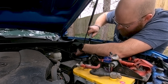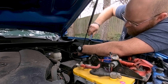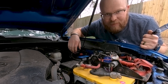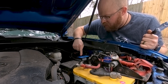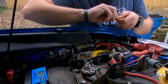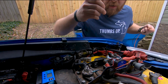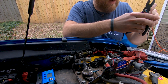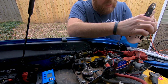I need some sheet metal screws, which I currently don't have, so I'm going to temporarily use these coarse thread construction screws — which I would never do usually, but, you know, times of crisis. So now we need to get the wiring situated. I'm going to wire this to the battery first and then wire from here to the panel. These Genesis trays make it really easy to wire accessories to the distribution block, and the distribution blocks are tied to the auxiliary battery, so your starting battery is used mostly just for starting and all your accessories run off those distribution blocks, which is really great.